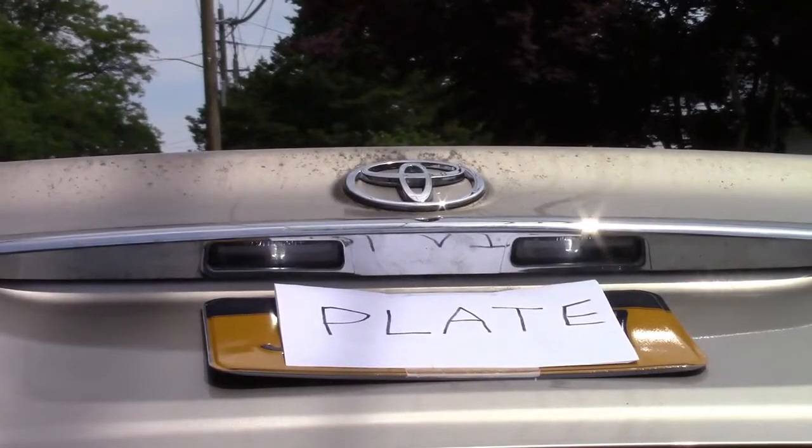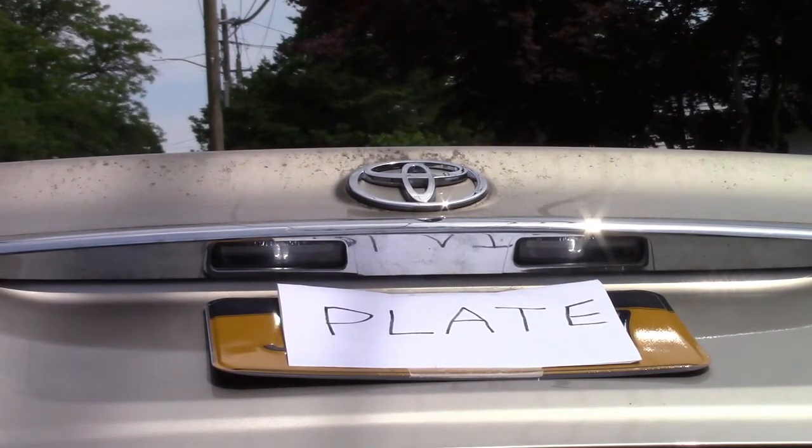Then the cover snaps right back on. If you wanted to jump in the trunk and try this, have somebody else handy to make sure you can get out if you did not put this back correctly. It's very hard to see in daytime, but you can see the LED lights in there. Here's what the car looks like with its original incandescent license plate lights, and here's what it looks like with the new LED bulbs — certainly a brighter white and easier to see. You can also see a side-by-side comparison of the original incandescent bulbs on top and the new LED bulbs on the bottom. If this video helped you out, please consider clicking the like and subscribe buttons — that lets me know I did a good job, and I can continue to provide them for you. Have a great day!